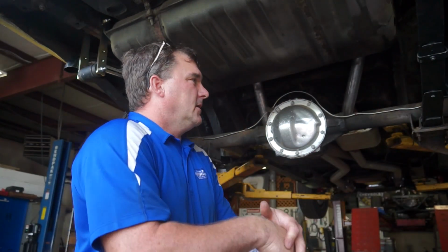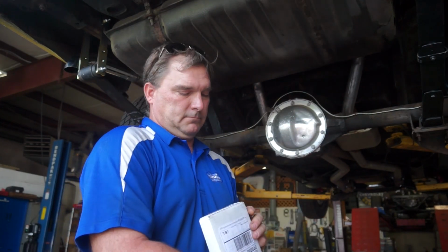And this one we're trying to sort out some ride quality issues. It had a very stiff rear suspension. It was on air shocks providing lift, so you have an air shock that's pumped up and basically you're riding around on 2 pogo sticks in the back of the car. So I put in new leaf springs, and then I used the McBay Performance rear shackles to get the altitude in the rear end that I'm looking for.